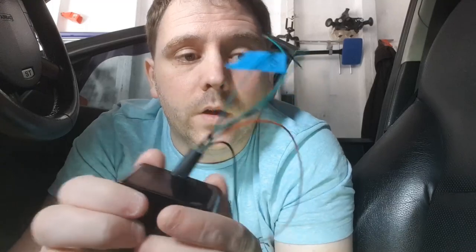I'm going to show you briefly how to install it on a Mark 3 Mondeo. For this kit to work, you will need to buy a bypass module for the immobilizer — there is a link in the description to one of those. You'll have to sacrifice a spare key of some sort, or a chip, or go to a dealership to get another one made up.